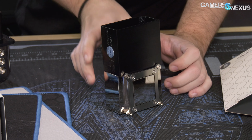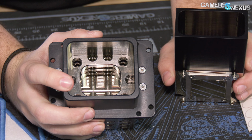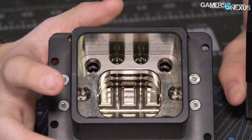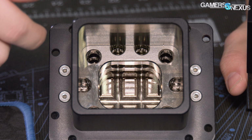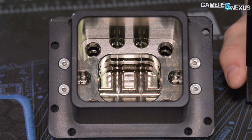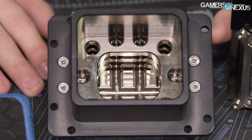And if you want to take a look on the inside of these things, they're pretty cool. So let's look at this one first for the CPU pot. You can see it's got holes everywhere where all the through bolts are going through. And what happens is with dry ice especially, you want to crush it into really small pieces, shove it in there, and it'll fill the base, and you put some acetone in that to help with contact to the rest of the cold plate. And having those chambers in there is also useful for LN2, which we won't be talking about today because we haven't done anything with it.